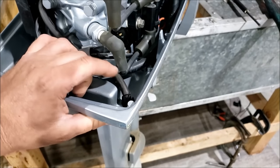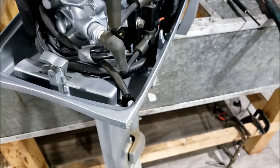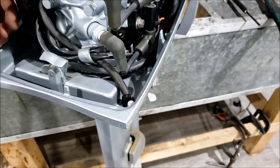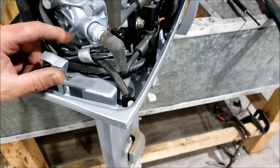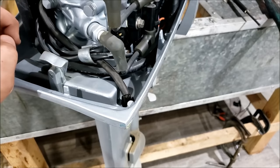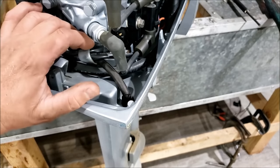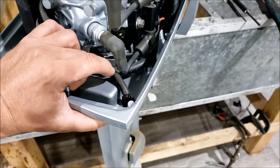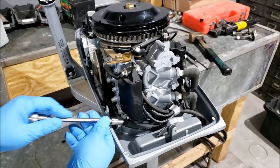This may be unique to this one hose, because the rest of them feel quite soft and pliable — mainly the pressure line and all of the fuel lines feel fine. They're not hard, not cracking, not dried, so I don't think I need to replace all of the lines. However, I did buy a whole bunch of them just in case. I think all I really need to do is change this hose and the water pump. Alright, let's get this hose swapped out.